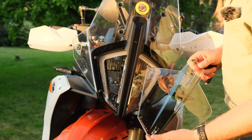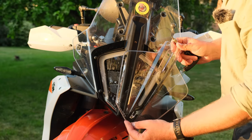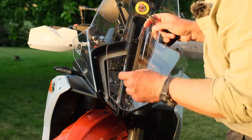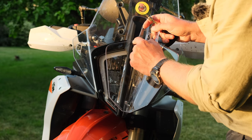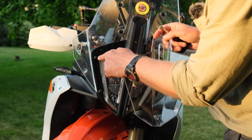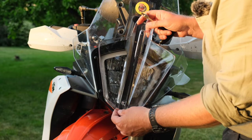As you see, I somewhat regretted mounting these rubber grommets on the headlight protection itself, and rather put them on this frame, so to speak. I did this because if you mount these grommets inside this edge here, the grommets do not get in a good position — they get into this edge instead of mating the best surface to do any good.